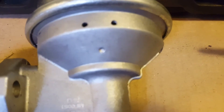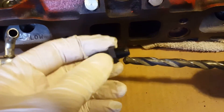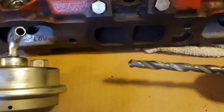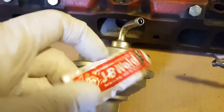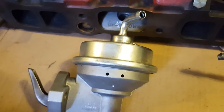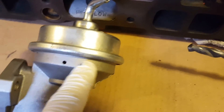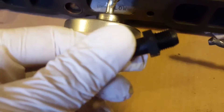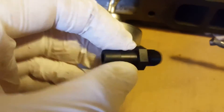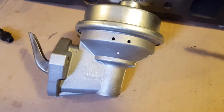I'm going to drill out this little dimple on the pump and plug these two vent holes. I'll drill it out with an appropriate drill bit - it's about the same size as the threads. Then I'm going to JB weld the nipple into position and also cover these holes with JB weld. I may do two layers. This nipple will make things look relatively stock or at least professional.